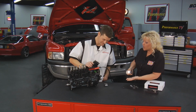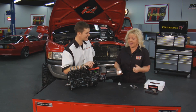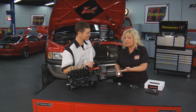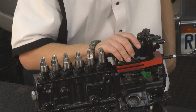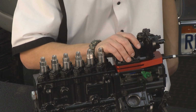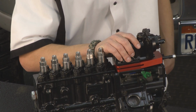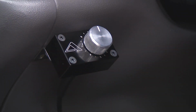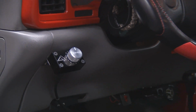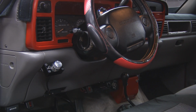Yeah. And whether you're towing or whatever you're doing, like I was mentioning, with more boost, we love that, more horsepower. You're going to make your pump last a whole lot longer because it's not having to do so much of a job, because you're letting it give more fuel. And we love lower EGTs, especially for you guys that are towing a lot of loads and through mountains and stuff like that. Exactly. Well, you can lower your EGTs like, what, 200 degrees? 250 degrees. Whew. That is a lot. Think of all the improvements that you can make with the adjuster.